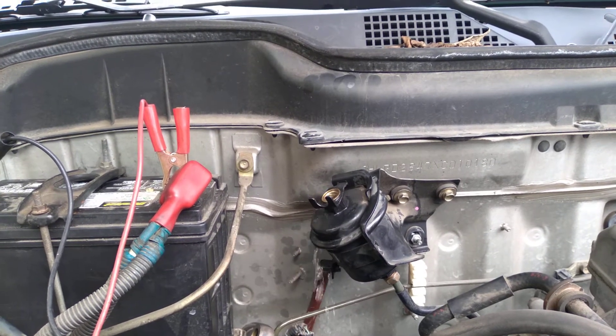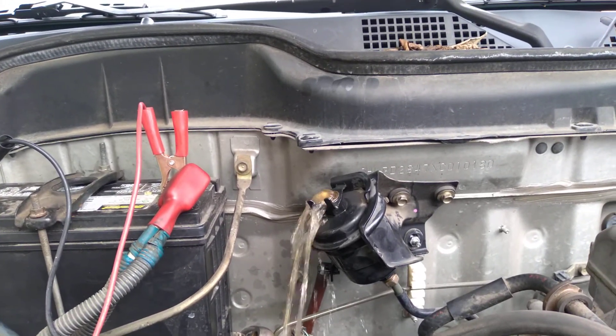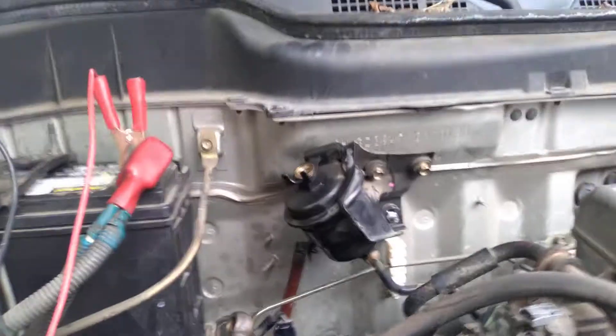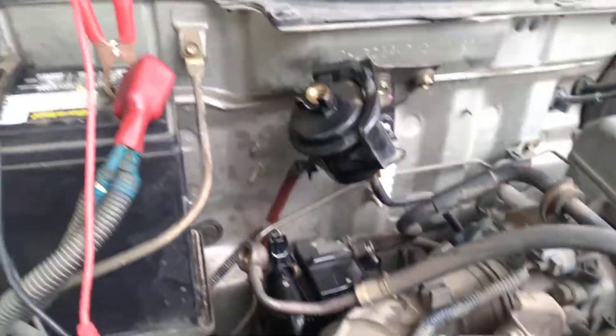Whoa — oh, stop. Don't try to turn it all the way on, just to on. Stop. That's how you check fuel pressure. The fuel filter is good — it's not clogged up or anything. You can see it's shooting out the top. That's how you do that.